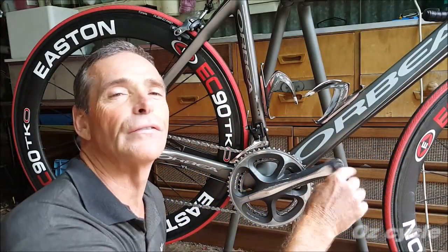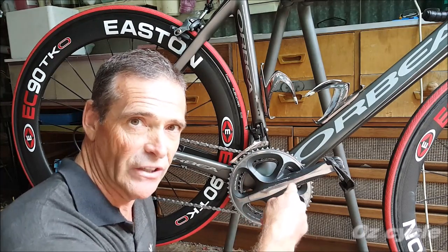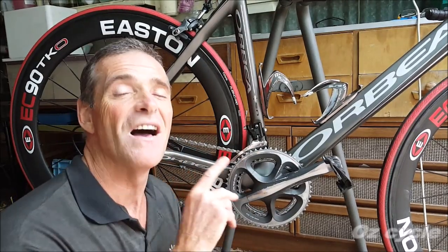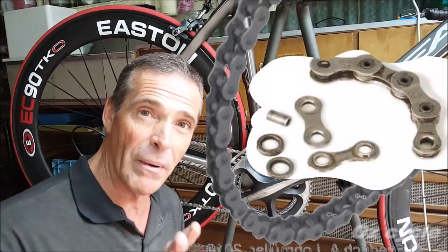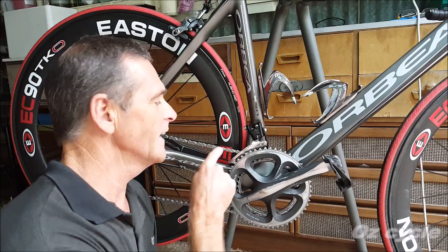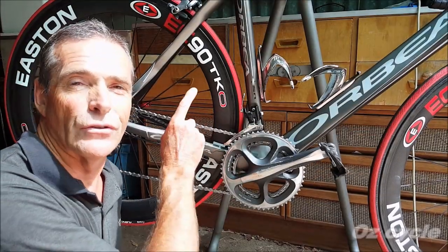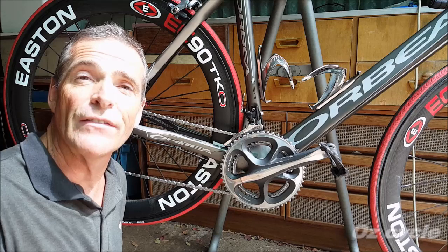The drivetrain is what transmits the power from your pedal to make your back wheel go around. It consists of your front chain rings, your chain, and your rear cogs at the back. The hardest working part of your bicycle, believe it or not, is your chain. Each link has moving parts, and there's no ball bearing races in the links — it's just metal on metal, sliding. It's moving all the time and has to deal with wet and grime because it's completely exposed to the elements, unlike sealed bearing races. So it's no wonder that your chain wears out first, and then starts wearing your rear cogs and front chain rings.